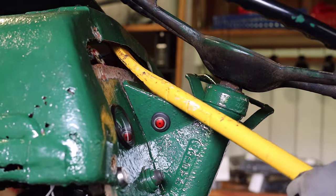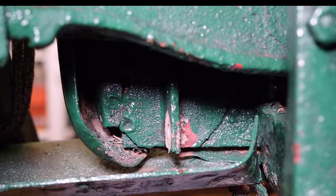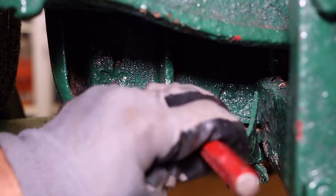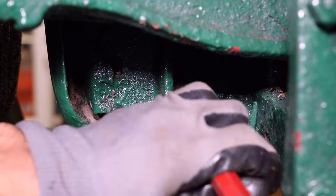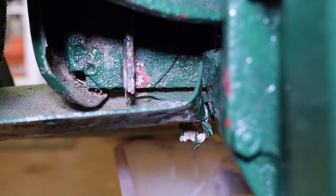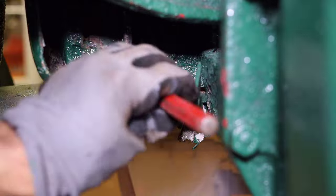I was able to pry the rear of the hood and confirm that it was free. Along the bottom of the hood and the skid plate you can see the two 90-degree mounting bracket pieces. On both sides these were rusted together almost like a pinch weld. I used the grinding tool and a cold chisel with a hammer to help break the mounting brackets loose. What is not seen are the multiple locations between these mounting plates and the radiator mount that are in front of and create an obstacle for each of the other pieces.